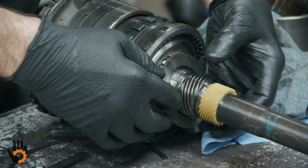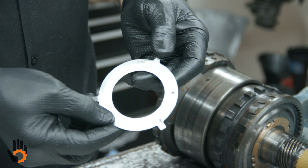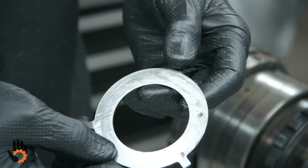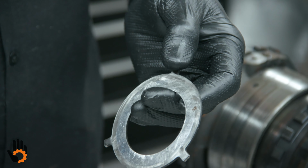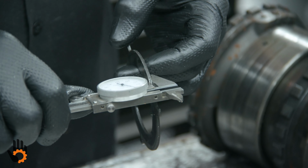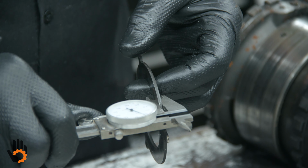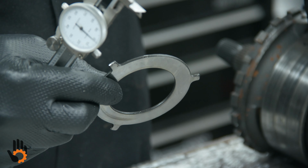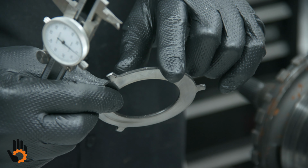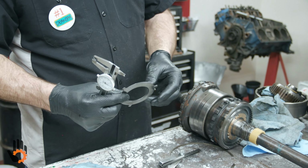And in order to do that, just so you know, this is the guy you've got to change. He comes in about 6 different thicknesses, starting out, I think, at 75 thousandths or so, give or take, up to about 115. So this is about a 92 thousandths. If we needed to tighten this up and get rid of some of the end play in there, of course, we just go to the next size up, a thicker washer, or thinner as necessary to open up the clearance.